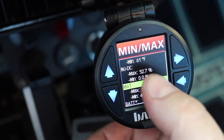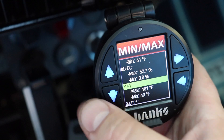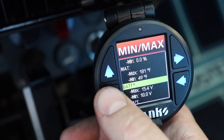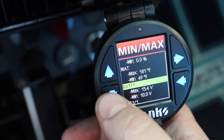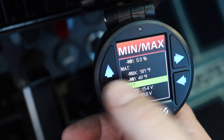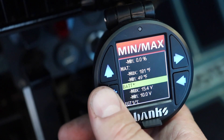Injector duty cycle — the max I've used is about half the injector capacity. I have the boost set at only 12 psi for all the data that's in here, so that's part of why we haven't maxed that out. Manifold air temperature — that's a thermocouple right underneath the throttle body. Being a Slant 6, that intake gets pretty hot.